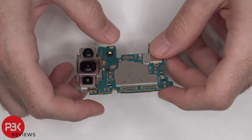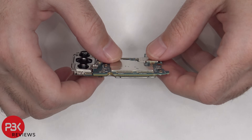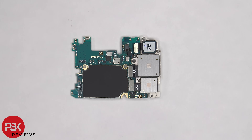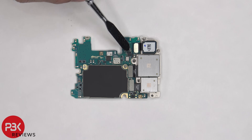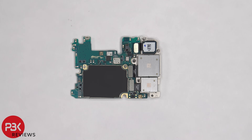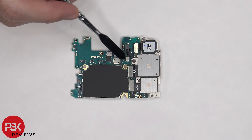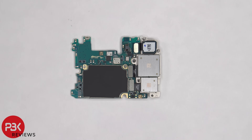The main board is a dual-layer board design. The camera connectors are located on the back, and they can be disconnected by just popping them off. The proximity sensor is located next to the top camera connector, and there's graphite film on the back shield to help transfer heat. The third microphone is located right here, and that's the microphone for the back, which picks up sound from the flash diffuser.